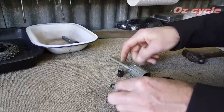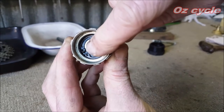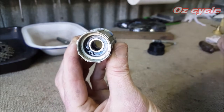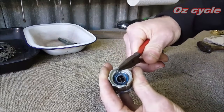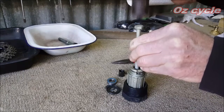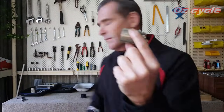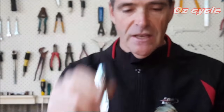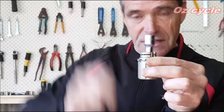It's all come out. You'll probably notice this one has a circlip in there — see the two holes of the circlip — so you need to take the circlip out before the bearing comes all the way out. There's the circlip. Continue hitting away at the bearing. If you have trouble getting that back bearing past the next lip, use a socket extension from a socket set — drop it in like that, it'll hold it nice and central — then just tap it out from there.